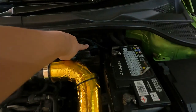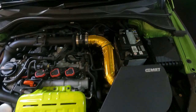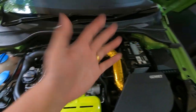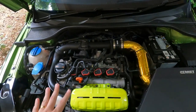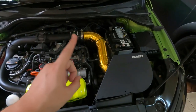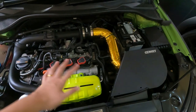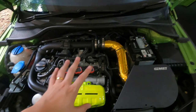Another thing is I did remove my race chip. The race chip is now a dummy plug because it was causing clutch slip, damaging the car, and causing the engine to judder — it was giving me a whole lot of issues. I might get a stage 1 tune soon, but for now I have warranty on my mechatronics and clutch since I changed it at Volkswagen. So in terms of tuning, I'm still putting it on hold.